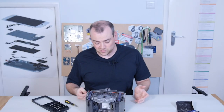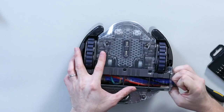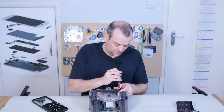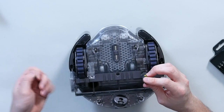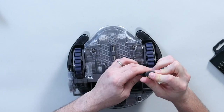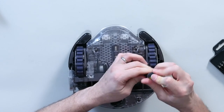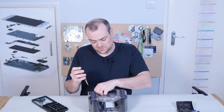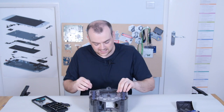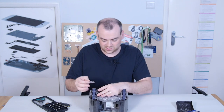I find it a bit ironic that this is a consumer replaceable part, so they make these giant slots which are coin operated. I have taken a few Dyson products apart just for personal use, repair, cleaning. And they're a little bit paradoxical, because the build quality and design is normally excellent — such clever, well thought out designs — but designed for manufacture, assembly and operation, not for maintenance. You tend to find there's a lot of plastic catches and clips, and notably they tend to use a lot of ABS, which is just not as resilient as nylon.